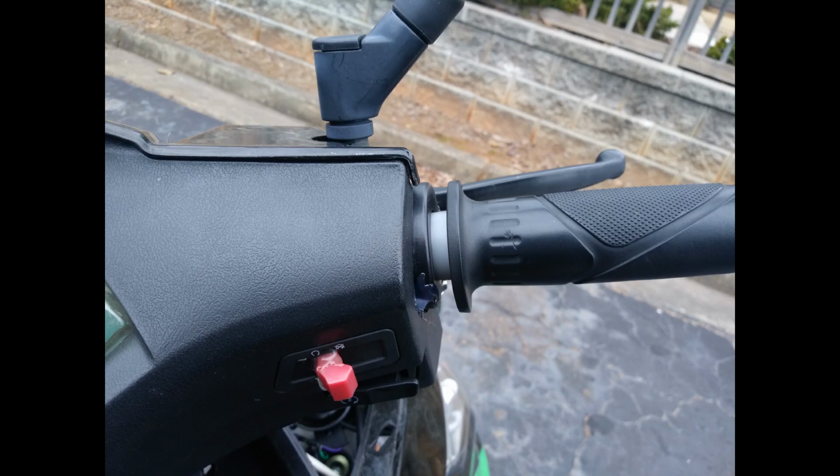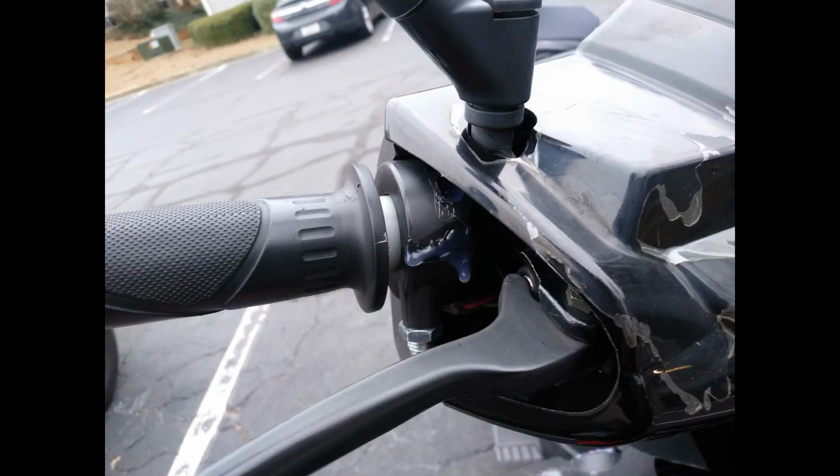I've been having this problem with my bike this winter where the throttle cable is freezing up on me. Like I could be leaving the house in the morning and it seems alright, but by the time I hit the main road, it actually freezes open. So I let go of the throttle and the bike's still going full speed. So you gotta just turn it off and abandon the thing till it thaws out.